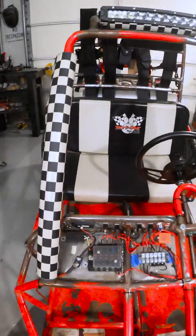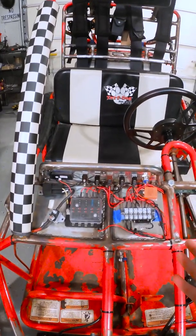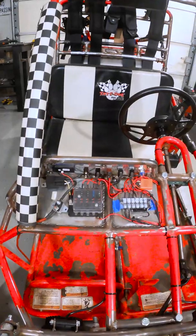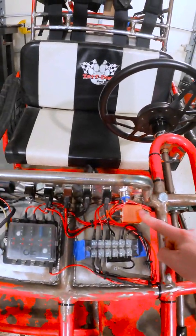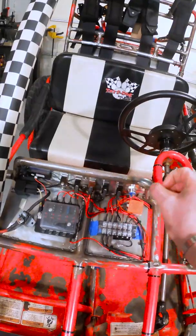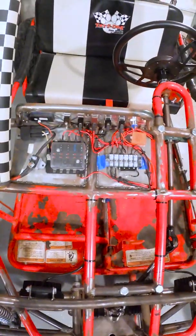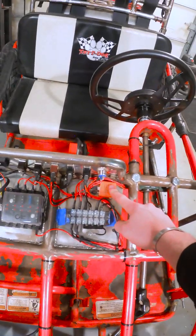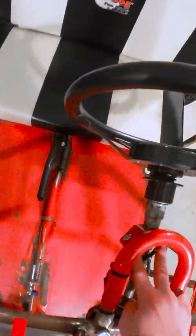Let's get a good look at this electrical system. We did four videos dedicated to this system on the red cart — you got to see me basically design, work through, and figure out exactly how I wanted all this to work. The first and most important thing you're going to need is one of these — a flasher relay. The flasher relay is what gives us the actual blinking for our turn signals. Power gets fed into this fuse box and then fed to the flasher relay, so the flasher relay is hot as soon as you turn on auxiliary power, then splits to our two individual buttons.